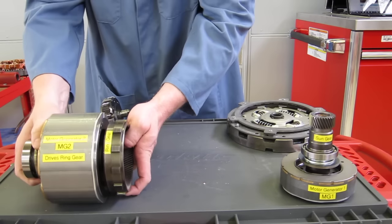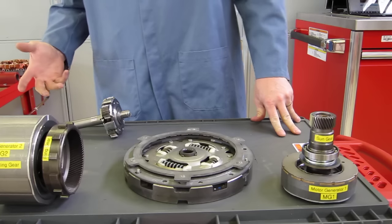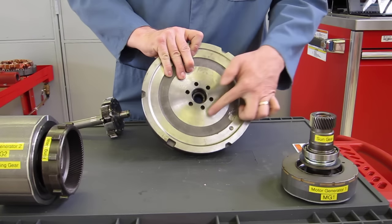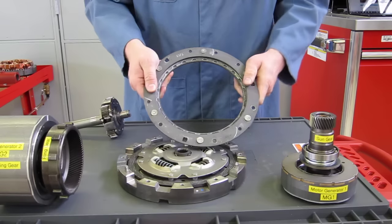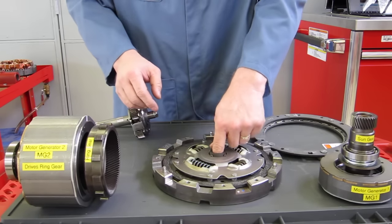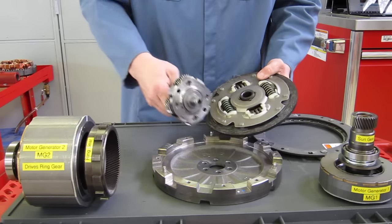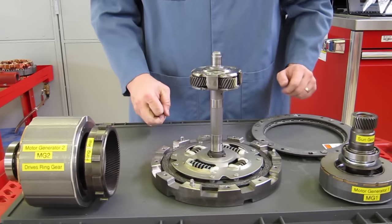This assembly includes the equivalent of a torque damper, which replaces a torque converter — this automatic continuously variable transmission has no torque converter. We have a flywheel, very similar to a manual transmission, that bolts to the crankshaft. There's a beveled pressure plate keeping constant pressure on the clutch disc. This clutch disc is always applied, engine-driven, and drives the planet gears via the planet carrier. If the engine rotates at all, so does the planet carrier.